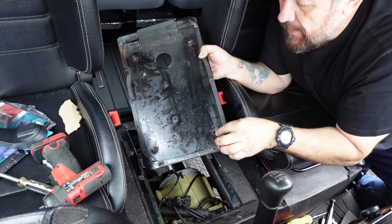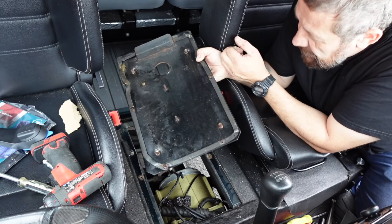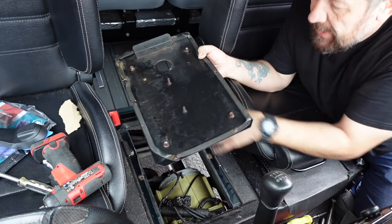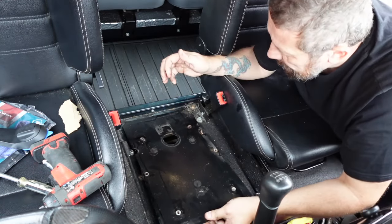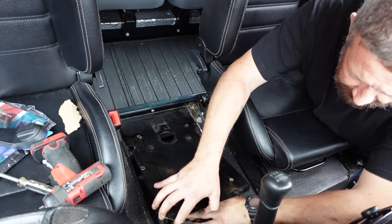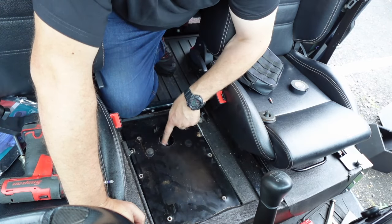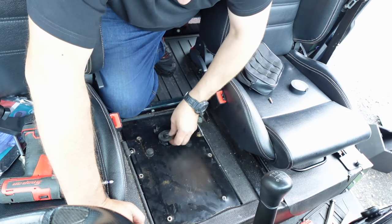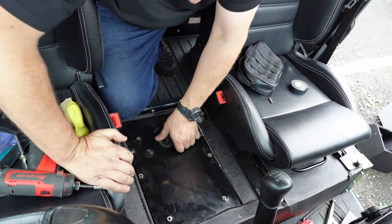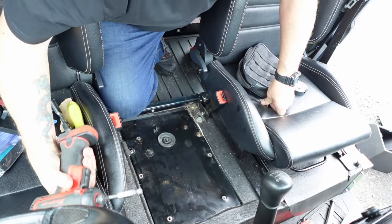We've actually got all the bolts out and managed to salvage the rivnuts. It was just super corroded under there — obviously there's loads of moisture and they're not really built for being installed externally. So we can now hop this back into position and just make sure everything lines up. That electrical connection, which we weren't quite sure what it is, we've taped it all up, wrapped it in cling film. We'll put the grommet back in place to keep moisture out of the cab, and then we're going to be ready to just screw everything down.